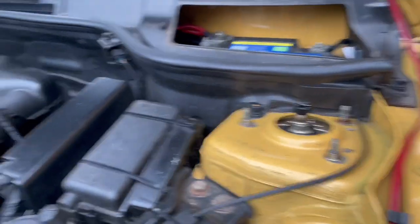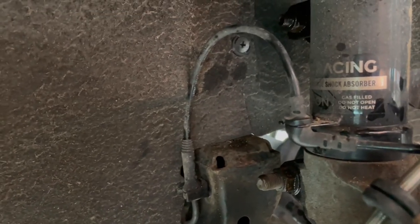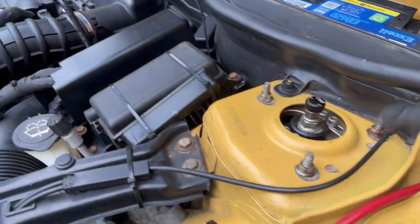The R56 front struts are easy to get off. You've got three bolts at the top, then lines that need to come off, the drop link up here that needs to be undone, and then right down here you've got this lower bolt. So: the drop link bolt, the lower bolt, and the three bolts up top. The order of service for removing is: do the drop link one at the top first, then the lower one, then undo the three top bolts — and you should be able to drop the strut out.